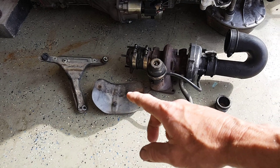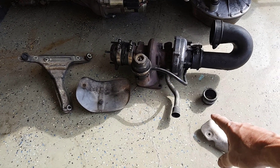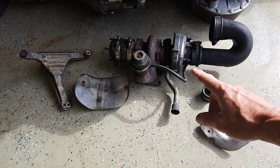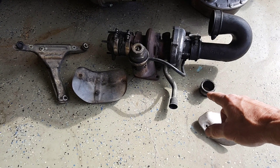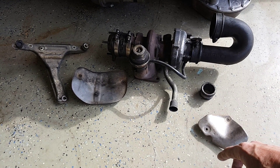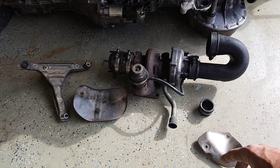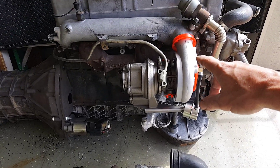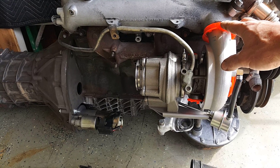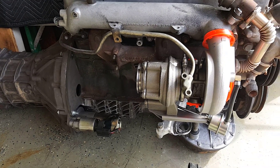The air cleaner bracket I took off, and naturally the old turbo. Here is the coupler that mated the original stock turbo to the intake manifold. The easiest route to success would be to weld that in, get a silicone coupler, and run that to an intercooler. And then on the whole outlet side here, I would turn this around, get a V-band, and run that to the other side of the intercooler.